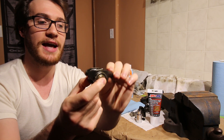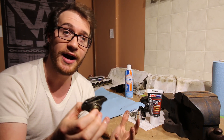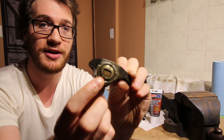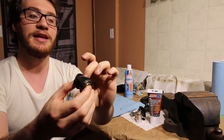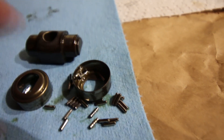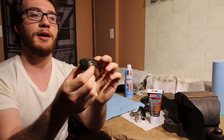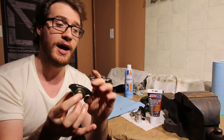Now the type of bearing this is is actually a needle bearing, but it's an open needle bearing. What that means is, as you're revving higher and the strain on this bearing gets higher, the potential of these end caps — there's a cap here and a cap on the other side — actually coming loose and working themselves out is higher. And the issue with that is, because of the floating needles inside, once this cap comes off the needles are going to be going all over your engine causing much bigger issues. So what these trunnion kit upgrades do is replace this intersection and the bearings on the sides with either an enclosed bearing or a solid bushing option.